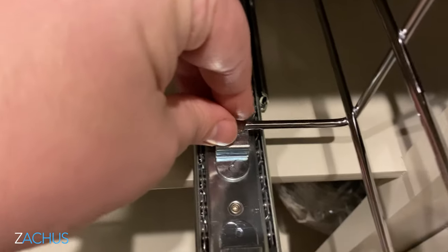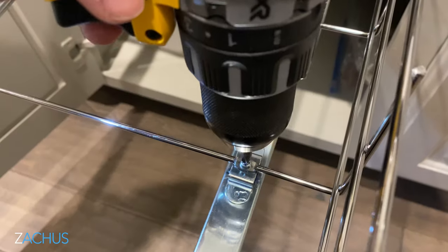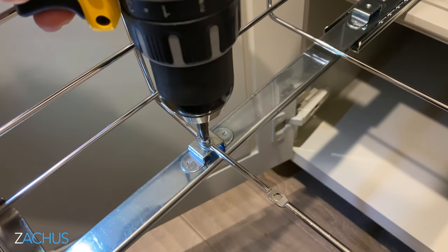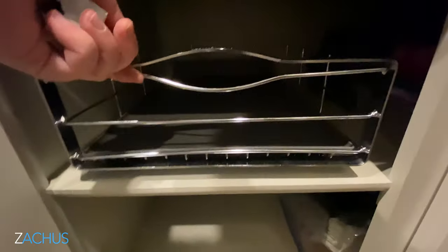It took me literally 10 minutes, maybe less. Once you get that in there, put the tray in, line it up, and start the screws with your fingers on all four of them, then get your drill back out. Don't snug them too tight if you have a really powerful drill — just get it snug. You don't want to break it or strip it out. Once you get all four snug, take that tray — the little lip goes in the back — pull the drawer out, put the tray in at an angle from the non-lip side, lay it down, and snap that lip side in the back. You'll hear it audibly click click click.